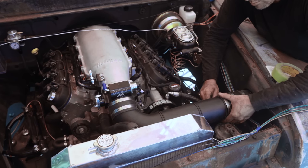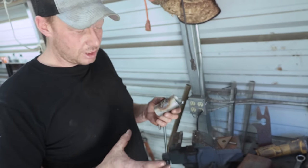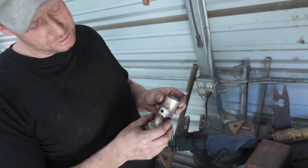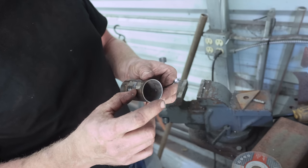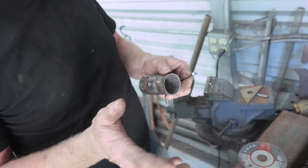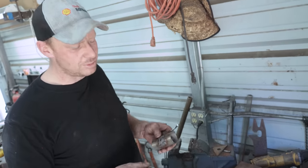So our radiator had a bigger outlet than on the thermostat housing. So I grabbed the hose that fit on the lower radiator, and that is kind of loose on this pipe, but we needed a joiner. Now the lower radiator hose from GM that fits tight on the thermostat, I can just squeeze over the other end. So it's a nice way to adapt it over.